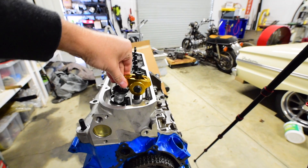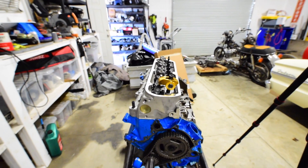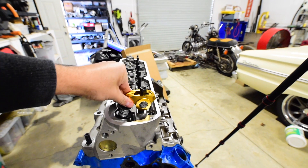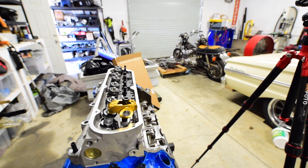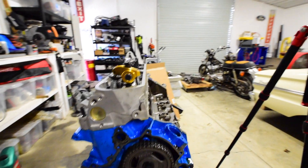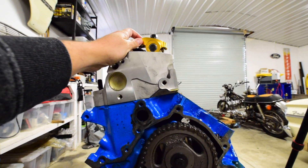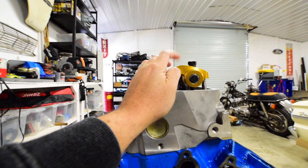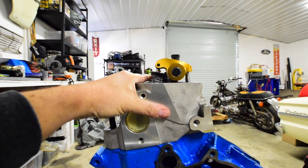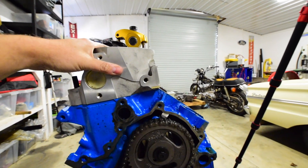My problem is that looks good right there, but when I roll the cam up or when I roll the pistons up, I do not get this. Let me just roll the engine over and I'll show you what the problem is. So right here, I've got the cam rotated about a couple degrees after top dead center, and you can see by pushing down on the valve spring, I've got zero piston-to-valve clearance. The pistons are solidly contacting the valves — so that's clearly not going to work.